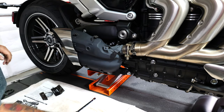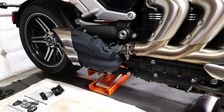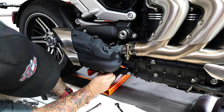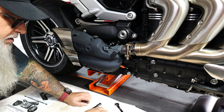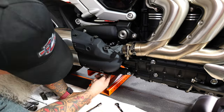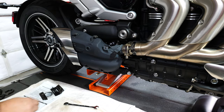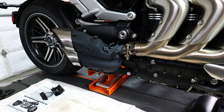Now we'll work on this other bolt — again that's 12 millimeter — start on this side. It's got a nut on the back. Here's your bolt and nut on this side. And you've got these little gaskets that go in here — they pull out like this. They sandwich in there, so if you ever put it back on you want to make sure you have those. So we go on the other side, you get the one in the middle which is up here and another one matching this side down there — also 12 millimeter. That one has a nut on it as well, and the same bushings.